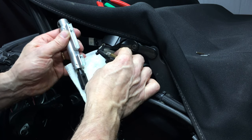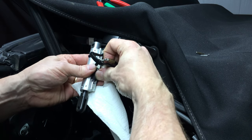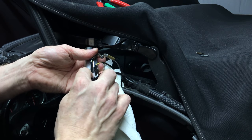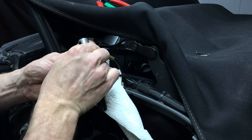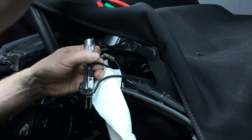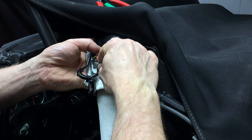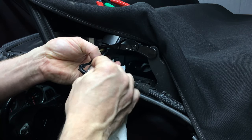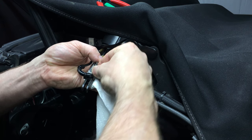Let's put the travel sensor back on first. We have the travel sensor, and we remember that the blunt end of the cylinder gets the even hose number and the shaft end of the cylinder gets the odd hose number. We push these fittings in straight and push the clip back in.